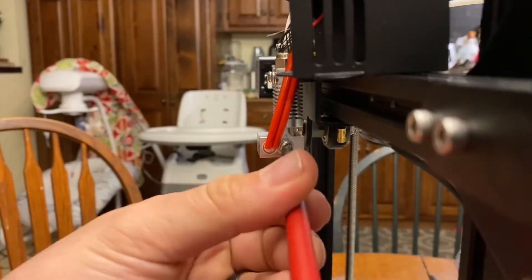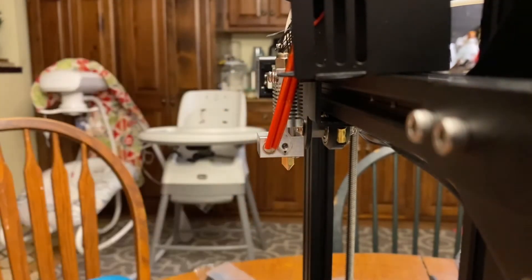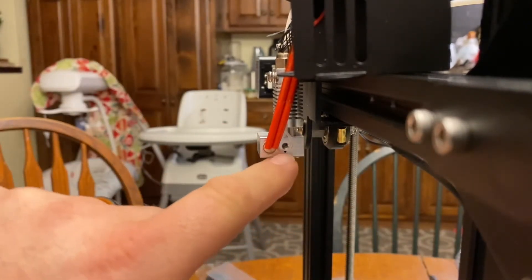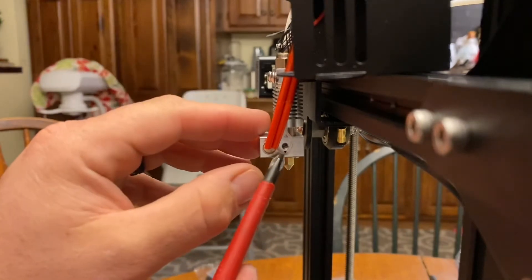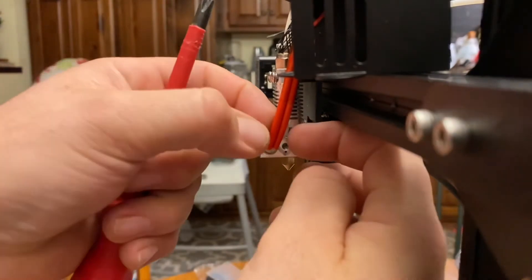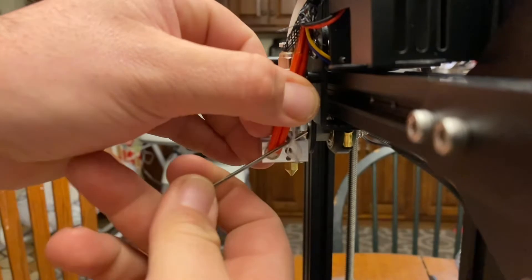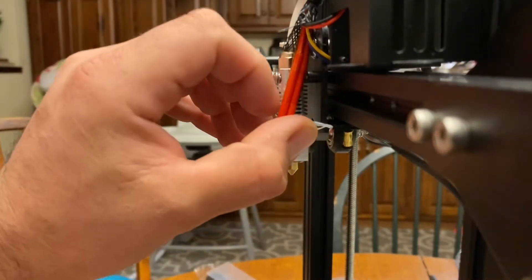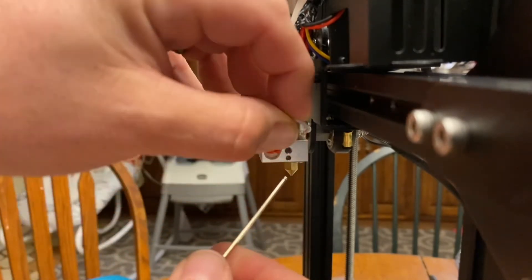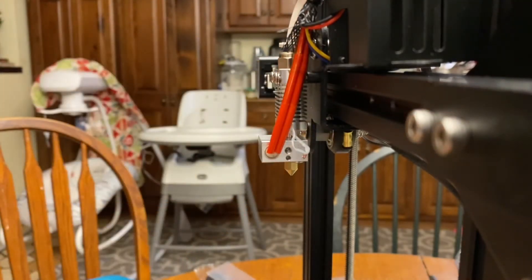And if this grounds out to the heater block, there's a safety that cuts it out. Be careful because it's a really tiny screw. If it grounds out at the bottom, that's what causes the issue as I understand it. So let's pull it out. You can see right here there are some exposed wires right there, and that's exactly where it goes into the block.